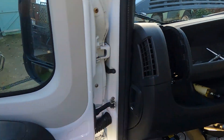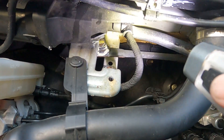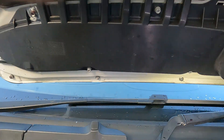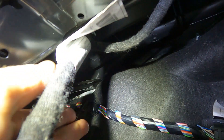What I've recently done is taken off the side pillar trims, and just down there you can see that creamy coloured stuff — it's a section that runs all the way from one side of the van to the other. If you notice, the windscreen is bowed, it's bevelled towards the middle, and that same structure runs all the way across where the windscreen is bonded to. Just up there you can see that structure, and if I put my finger on what looks like a vent hole — a drain hole — it's wet.